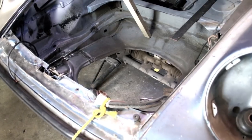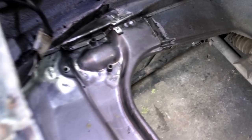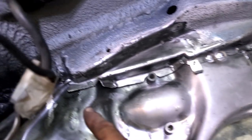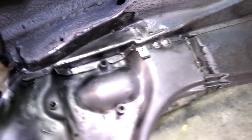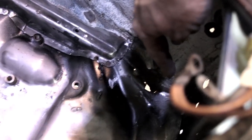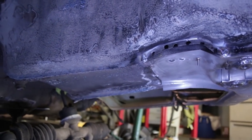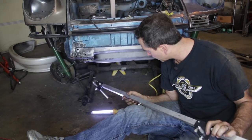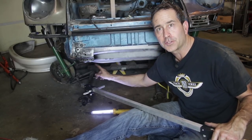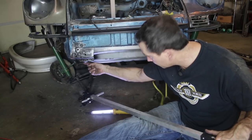I have a little bit of good news. The diagonal jack is gone and I've been able to get a few tack welds in — there's one right there, a couple right here, some here in the corner, and some on the outside as well. Moving over here, a couple tack welds here, here in the front — I'm trying to hold this diagonal position. I've been using this tram gauge over and over again to make sure the position of these suspension points are the correct distance from front to rear and on the diagonal.